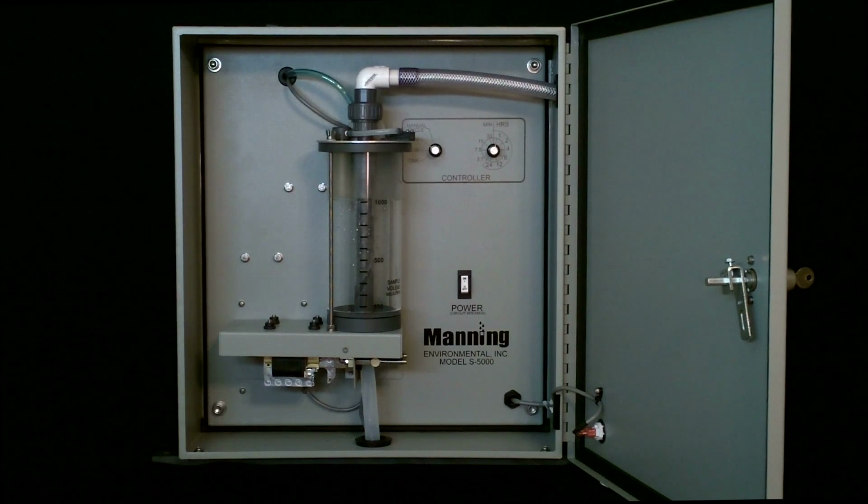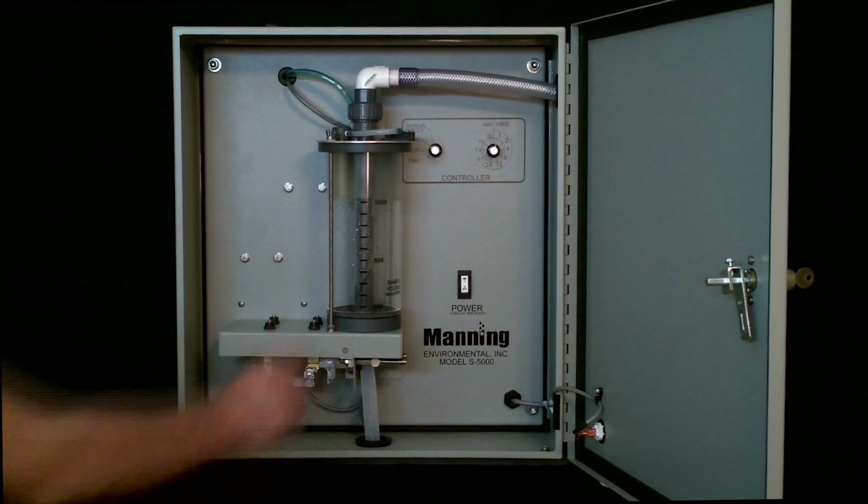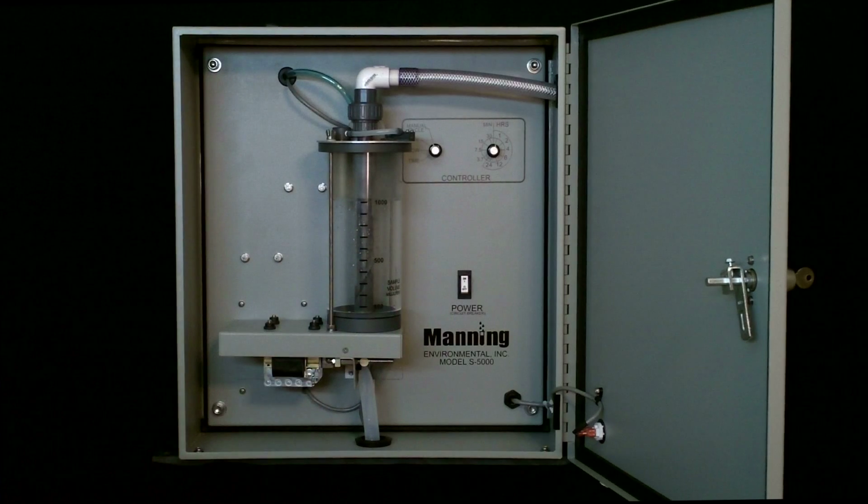The cycle on a vacuum unit is purge with pressure, draw with vacuum, measure with pressure, and deposit with pressure. The unit begins by purging. The unit then switches to draw. The sampler changes from draw to measure when the chamber is full. A pressure switch is what tells the unit that the chamber is full. The unit then deposits.